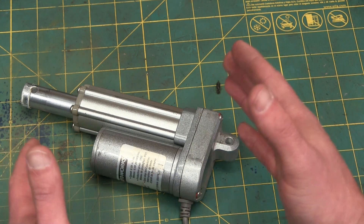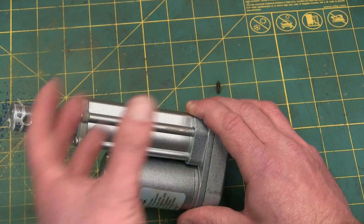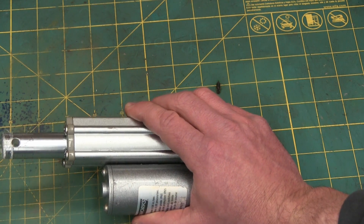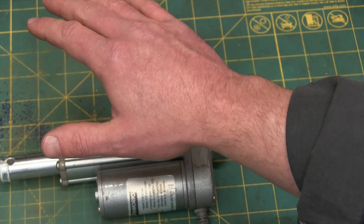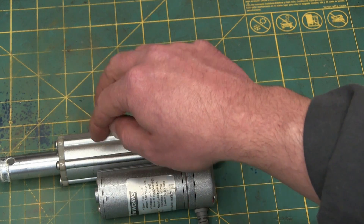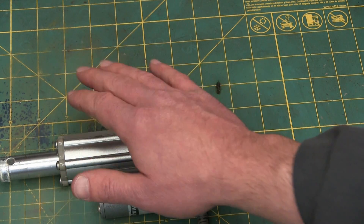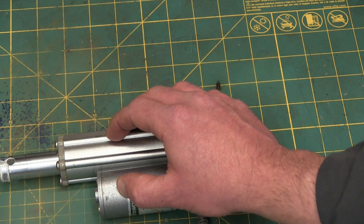The reason being some engineering constraints will get squeezed on the financial side and they'll say to themselves, hey why don't we replace this hydraulic cylinder with an electric linear actuator? Does the same thing? No. You don't have any overload protection on these little electric jobbies, whereas on the hydraulic, if you over-pressure it or spike it or whatever, the pressure spikes and the pressure relief valve goes over relief and eliminates that pressure spike. So there's mechanical overload protection built into the pneumatic and hydraulic actuator. There is no mechanical overload protection on these things.